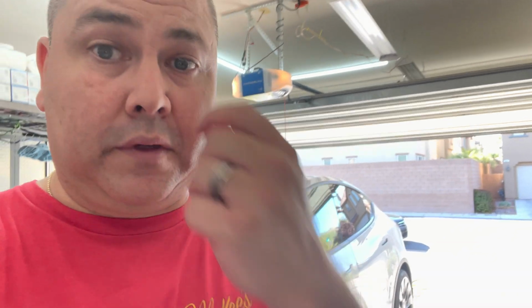Just finished polishing. I used the Gyeon primer. Now I'm going to use their prep spray, just to get any of that primer off, wipe it off, clean it real good, and get it ready for the coating. That's going to be our next step, and the primary focus of this video. But I just wanted to let you know that we did polish it. I do like this primer. It's just a jeweling polish, but it's real nice. It doesn't dust. It's got a nice working time and works well. So let me get to this and I'll be right back.